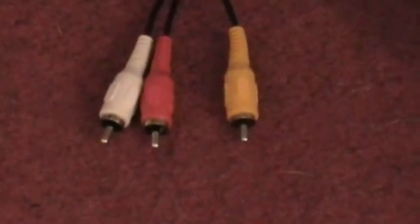You can see the dongle has audio in and it tells you left and right, so if you're unsure which is white and which is red, it actually labels them — which is quite cool. Now plug the dongle into the back of the capture card — it's got a little groove, so you should hear a little click. There we are. Below me are the standard PS3 cables: left audio, right audio and Composite.